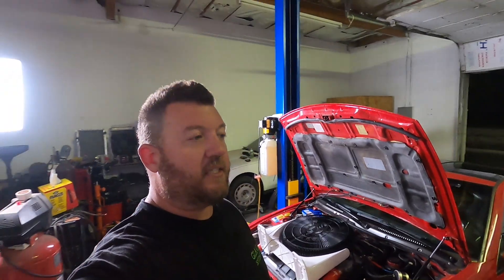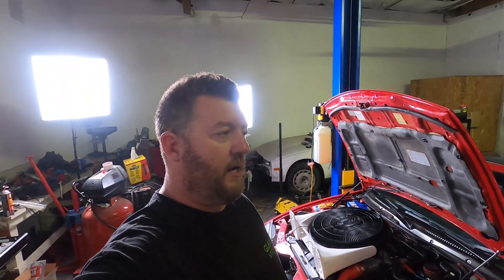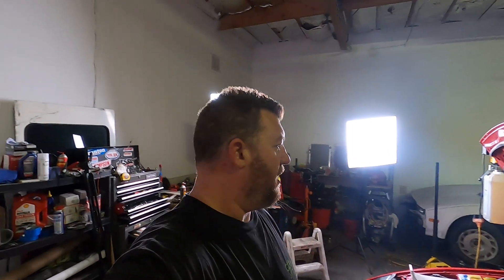As you can see, I got a fan cooling down the engine because I just drove it here. I turned it off so you could hear me over the fan noise. We're going to be installing the R35 GTR coils and installing the chip that has been reprogrammed specifically to change the dwell settings in the ECU to match the R35 GTR coils. This is from the BDE engineering kit — I'll post the links below for what I got.